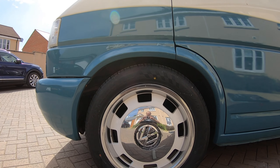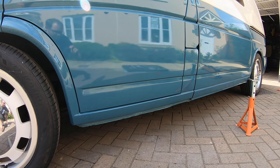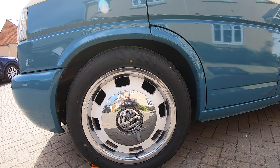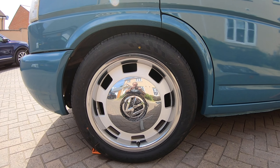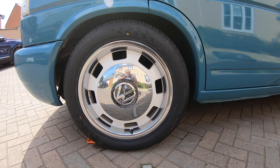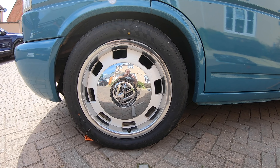The great thing about the T4 suspension is it's very straightforward, it's very simple, there's not a lot to it. The front wheels are held together on torsion bars, so there's no springs in the front. The torsion bar allows the wheel to go up and down and also sets the ride height.